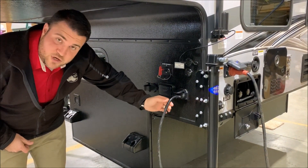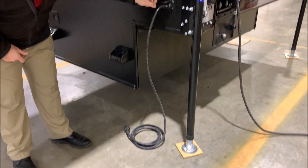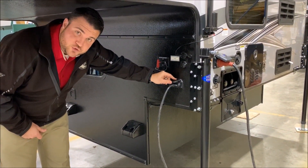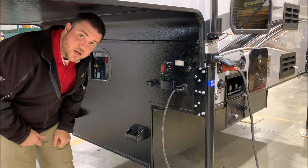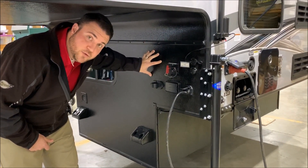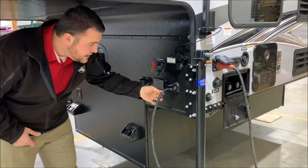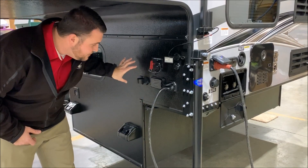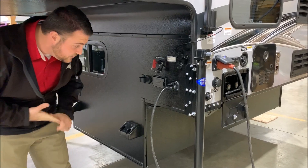The camper comes with a double-sided male seven-way cord. The connector on the camper is exactly what you find on the back of your truck — it plugs in here, the cord runs all the way back and plugs into your truck to power your clearance lights and charge your battery while driving. As a side note, if you're parking for the night or leaving the camper on the truck, we recommend unplugging this cord from the camper so a dead camper battery doesn't drain your truck battery as well.